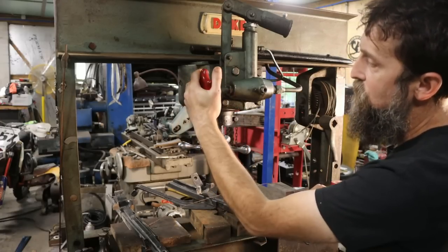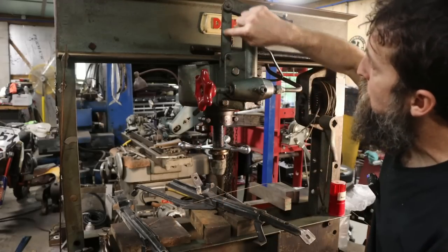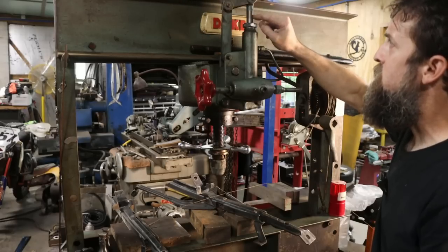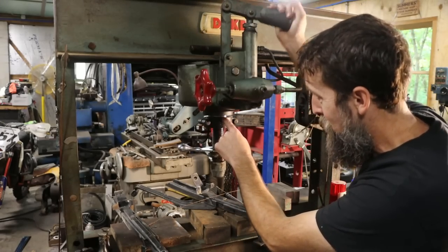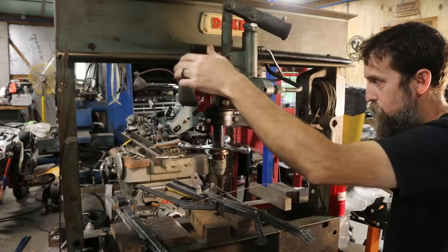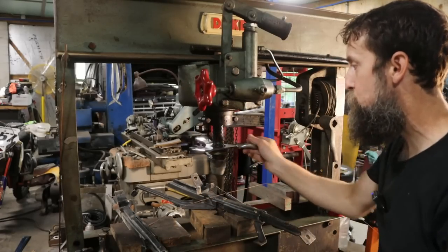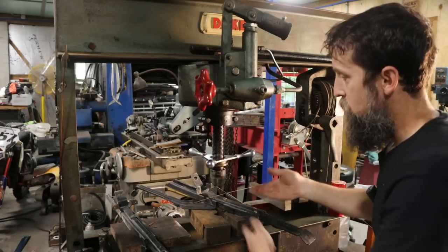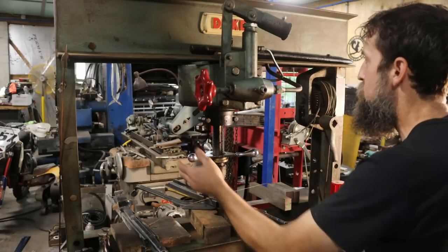The rod that comes out is half-inch steel with a plastic-dipped, really nice feel handle. So half-inch steel on the tie bar for the pump, and 5/8 or 3/4, I'm not sure exactly the size of that cylinder. It has a long throw that moves this thing down quite a bit, so it's not slow. Plus, it retracts really fast, which is nice. So if you're doing multiple parts or repositioning, this thing is really, really nice. Little ship's wheel there on a threaded ram, so you can just run that down just like that. And obviously you want to use that as tucked up as possible, but you get the idea, especially if you're doing anything that involves high pressure.